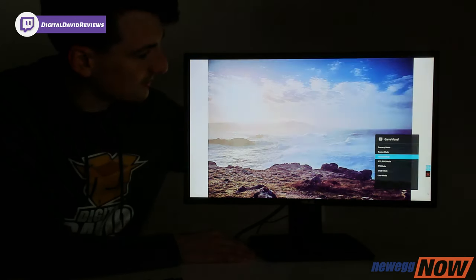You can see what it's like at 83 FPS, so half that amount. You can see, not bad at 83 FPS either. And then you can see 41, so a drastic difference between 41 FPS and 165 FPS right there. And again, that's what you're gonna get with lower end monitors with a lower refresh rate, 60 Hertz, that sort of thing. You'll be closer to that picture quality versus us up here with the 165 FPS with our 165 Hertz monitor.